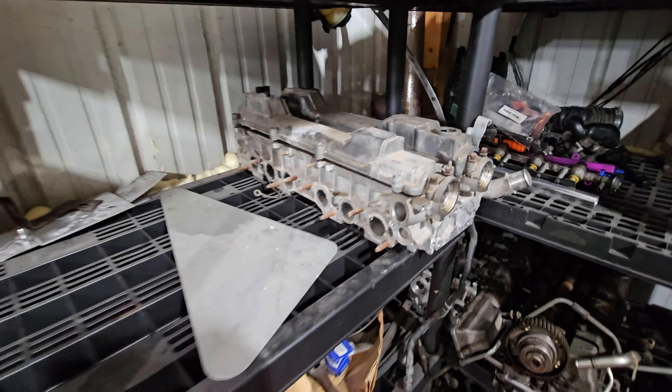It's been a couple days — yesterday it snowed, this morning it snowed, now it's 50 degrees outside with at least 50 mile-an-hour winds. So I did some thinking, did some ordering, and went ahead and ordered all my cams and everything for the cylinder head. This is actually a non-VVTI cylinder head that is still good. I'm going to be modifying it — I'm going to drill and tap the head to run a Haltech sensor or some sort of sensor for the cam.